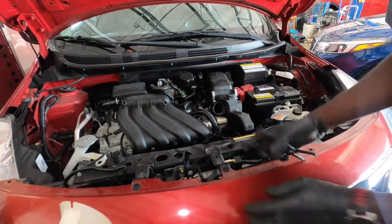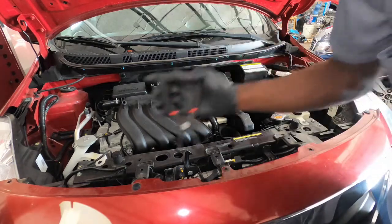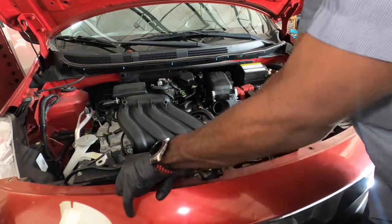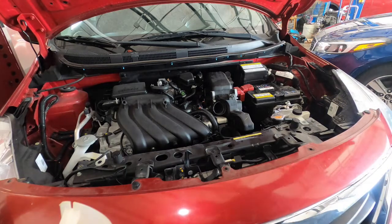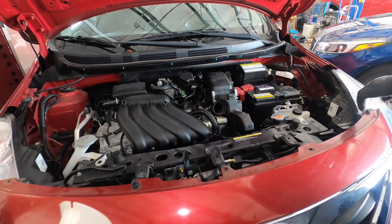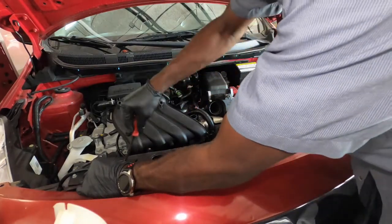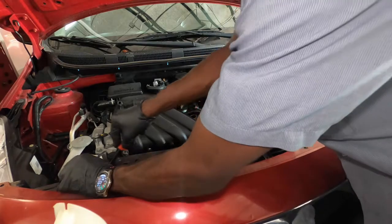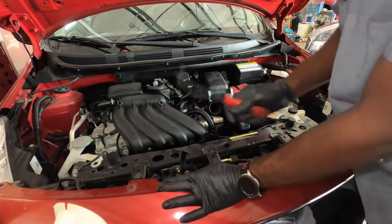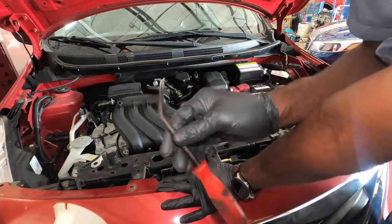The next step is to remove this right here. Go ahead and squeeze this. Link will be in the description for the tools to remove these clips. Some are missing already, so somebody removed some of them already. Once you remove all these clips around here, remove this clip right here, and this one right here also. That's for your horn. And this is the clip puller, and it will be in the description also.